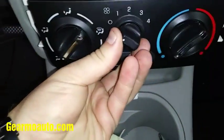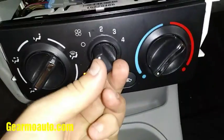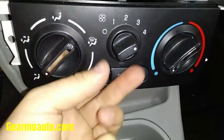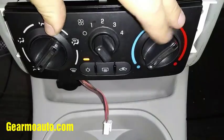Here's the problem I was having on this one: when I would go to one, my AC would work — the light would light up and everything would work fine — but if I go to two or higher, two, three, or four, then this light turns off. When this light is off, it means the compressor turns off. I would still get air coming out of the vents, but I wouldn't get cold air. I would only get cold air if the snowflake light is lit up.